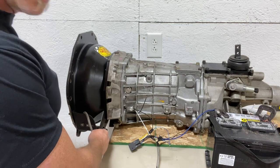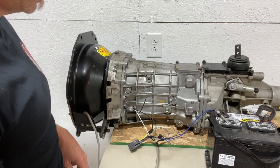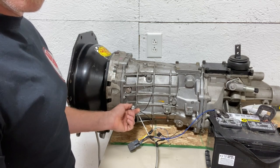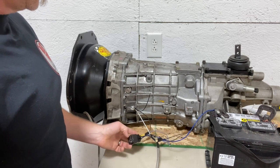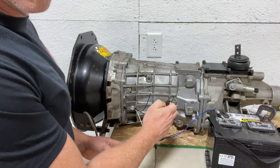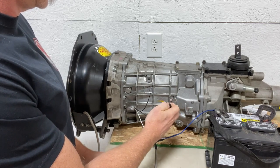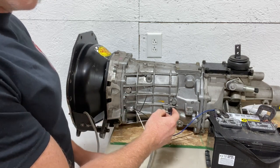Mounted here is a switch that the clutch fork can hit. That completes your ground circuit, which we'll get into later. We've got this LED, which is just an indicator — that's the equivalent of your two-step. You can use that in parallel on your actual install so that you have an indicator of your two-step being engaged. We've got this little tiny momentary switch, but generally this would probably be on your shifter or any kind of momentary switch mounted in your car. This is just one I had laying around.